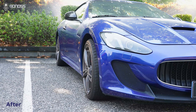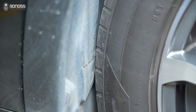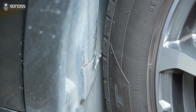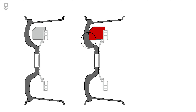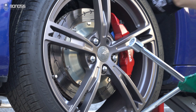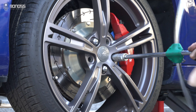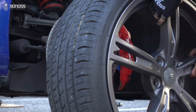These are kind of wheel accessories which are used to create distance on the inner portion of the wheel for clearance problems. By pushing out the wheel, you can get a small amount of clearance for bigger wheels without rubbing against the fender. Having a wheel brought out to the ideal distance allows for mounting larger brake calipers without wheel scratches.